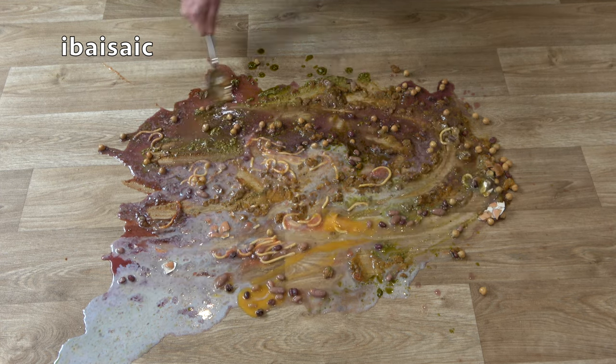So let's have another look at the brush roll. The cover still needs a manual wipe over. You can see there's still bits on it. And the brush roll, although it looks a bit cleaner, it's still got some grubby marks. I might need some mild detergent on that, wash that manually before putting it to dry in the included drying section, which just fits here. You've room for two brush rolls. The machine has been used for a very dirty mess test, so it is expected. If you're using this machine normally, the self-clean feature will suffice for most people, but occasionally it's best to take the brush roll completely out and give it a thorough clean.